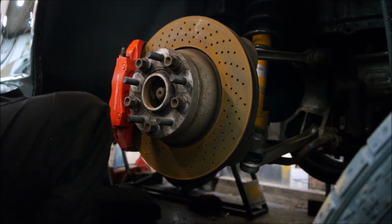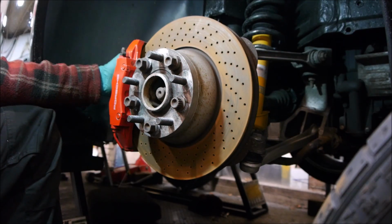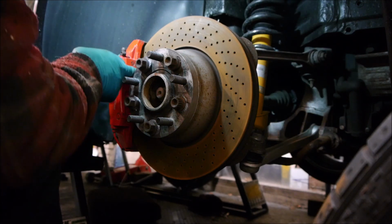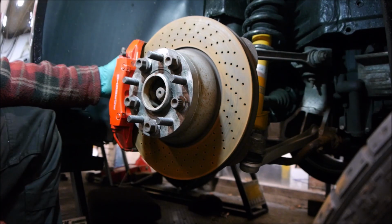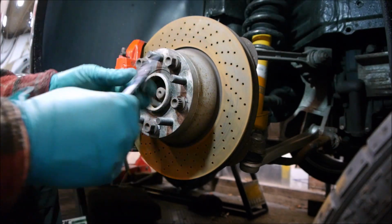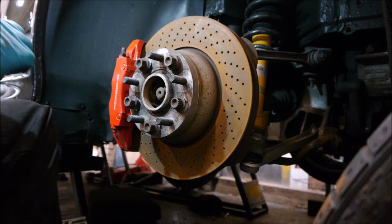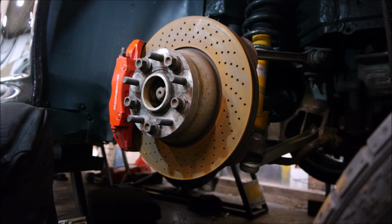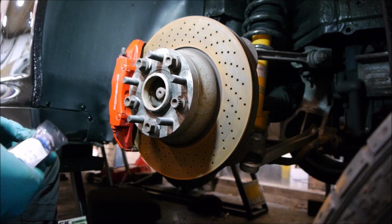So we're going to move on to the discs now, and I'm sure someone more technical than me will tell me the reason why, even though there's probably 6 or 7 mil left on these pads, why they actually go off with age. So I'm also going to clean out these holes here, and I bought some drill bits, 3.5 mil, and we're just going to run those through the hole just to clean them up. We're not trying to enlarge the hole or affect the integrity of the disc. We're just trying to clean the crap out the hole basically.